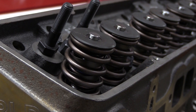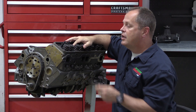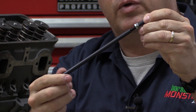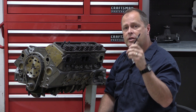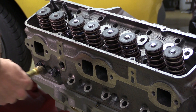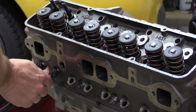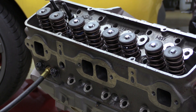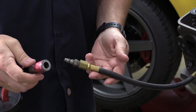The first step is to pull the valve springs off the cylinder head. You can do this with the head on the block or off depending on the equipment you've got. The reason you have to do that is the adjustable pushrod has a tiny threaded portion that runs in and out — it's not as strong as a real pushrod, so if you try to roll the engine over with it in place, the valve springs can put enough pressure on it to bend it. I like to do it with the head on the block — it's just simpler. I've got a valve spring remover from Moroso. The first step is to attach a hose from a leak-down kit and hit it with some pressurized air to keep the valve up against the seat.